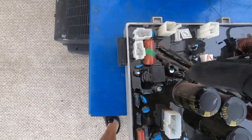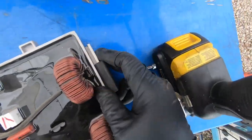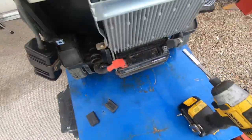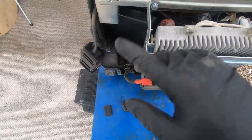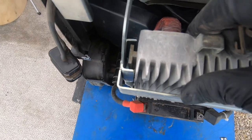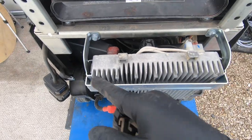I forgot to mention: on your old board you're gonna have to pull these rubber vibration isolators. That's the old board and I already installed my new board, so I'm showing you this before installation — I know it makes no sense. They're very important because without them your board will make a lot of noise. I have to disconnect this one, pull it out, put the isolators on, and then we're gonna go ahead and try to start it.